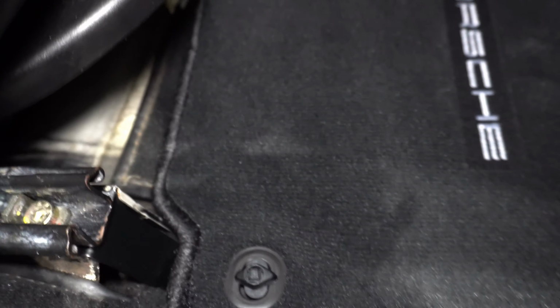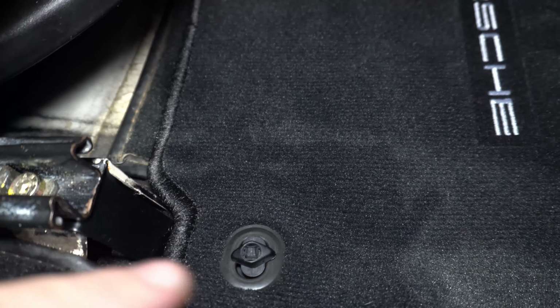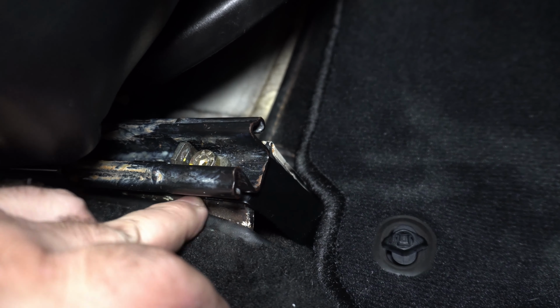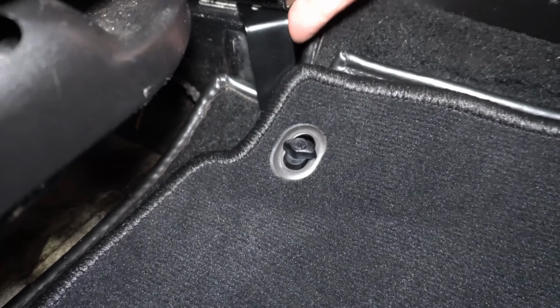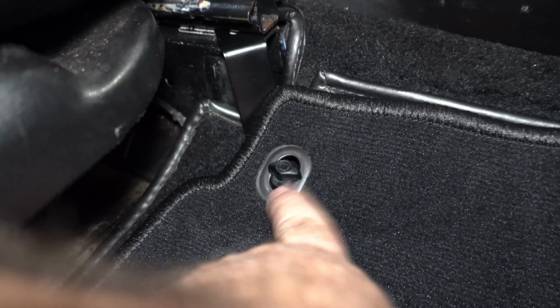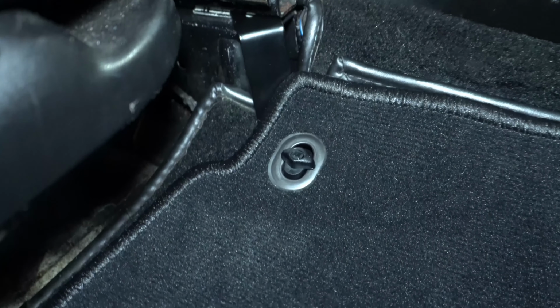I tighten everything back up in here. Yeah, so this bracket kind of goes straight out. Like I said, it goes between the rail and then the mounting boss on the chassis. And then this one on the inside on both driver and passenger, you got to angle it in and then twist the lower mounting boss so that it's even with this oval cutout, and then you can kind of get it in there. So that's passenger.